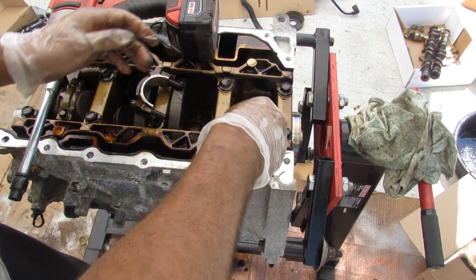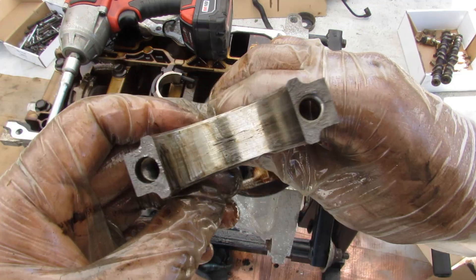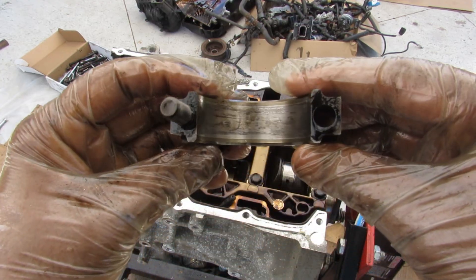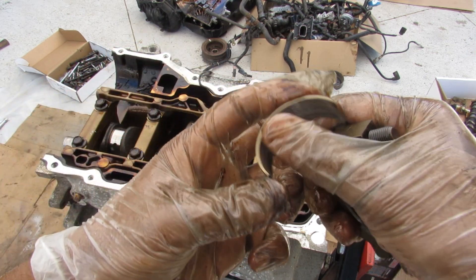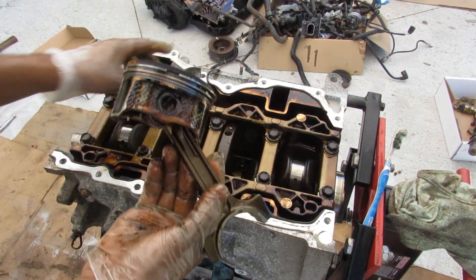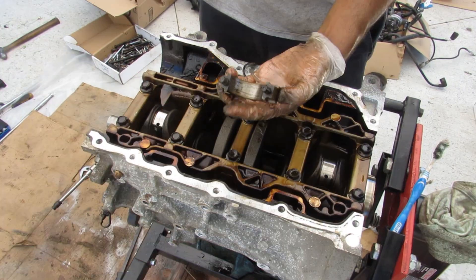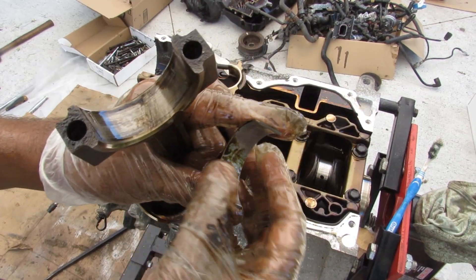Using the toothbrush to push the piston down — here's what that piston looks like. The end of this connecting rod is really black and all burnt up, and the bearing surfaces are all scored up as well. Continuing to take apart the rest of these connecting rods, piston number one also had quite a bit of overheating and scoring done to it, but it's not nearly as black as piston number four. The bearing itself is really chewed up on the inside and very rough, and this side is kind of burnt out — so maybe this one was going to spin next. Piston number three is not nearly as bad, the bearing is a little more smooth, and bearing number two is not nearly as bad either, though it is kind of burnt up. Piston number two probably fared the best.